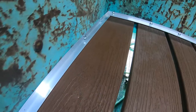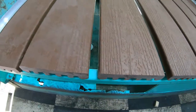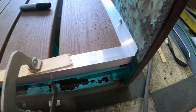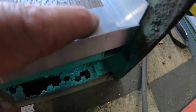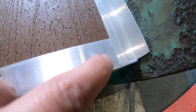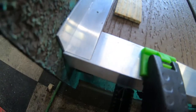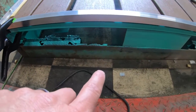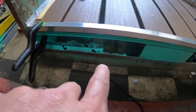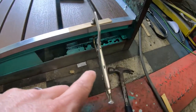There you can see I've got the hold-down aluminum pieces all along the inside edge of the bed. I have another strip that will go along this piece right here. Now for the back section to tie it all in, I've cut this piece long enough to reach all the way to the bedside. On top I cut it right down the side and down the edge on both sides. So there you see I made that cut. All this right here along the bottom is going to be replaced with some diamond plate - it'll tuck up underneath that aluminum and bend all the way along.